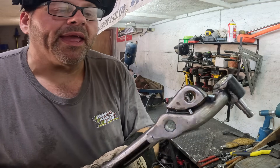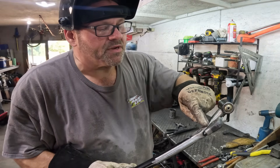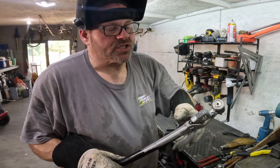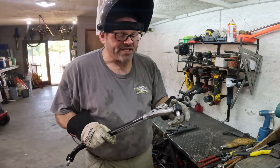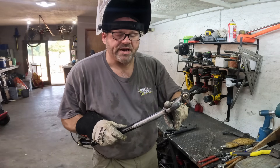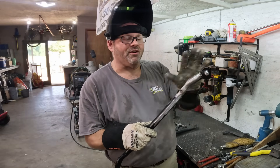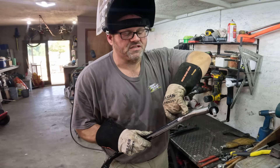See how I've got that on there — you can see I've got the bevels down through there. I'm going to take the next hour and fill it in. I'll have a rag sitting on this end and just consistently quench it — when the rag starts steaming and boiling I'll walk away and wait until it cools completely back down, then go back to work. I will not quench this directly because I don't want to make any of this become brittle. If it bent on the track it's just bent — you just never want it to fracture and break. I'm also going to fill that hole in because most rules say the center link can't be adjustable, and if tech saw two holes they'd say it's adjustable, so I just fill that hole in.